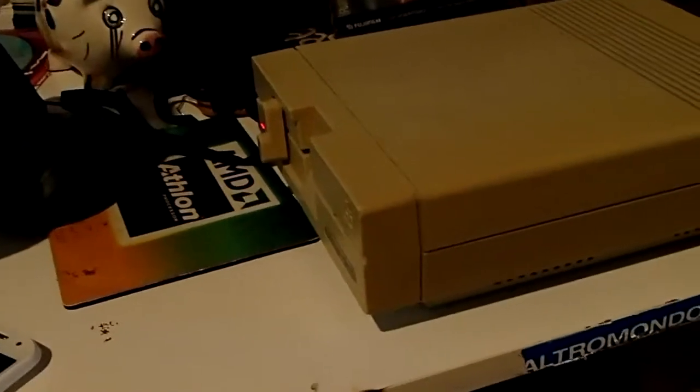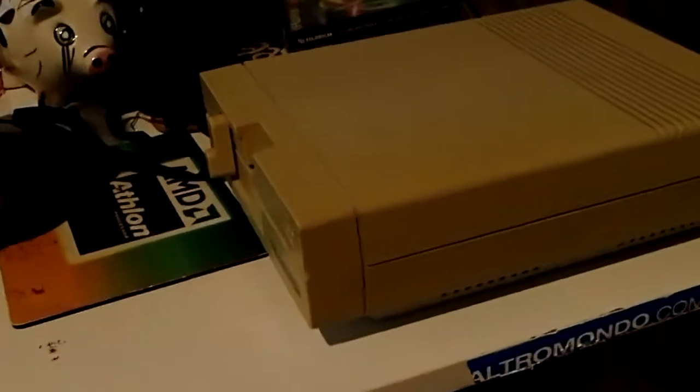I was starting to blame my cable, thinking my units were burned. Instead, the problem was simply that I had this very old floppy that was very, very dirty. The dirt was transferred onto the head of the drive, so I had to open the drive, clean it with alcohol, put some grease on the mechanism, and then the drive was working again.